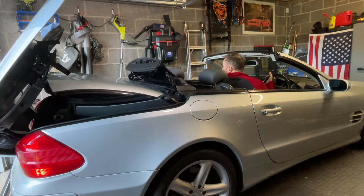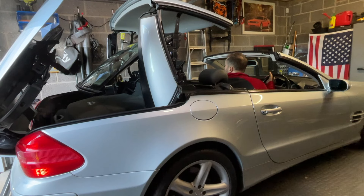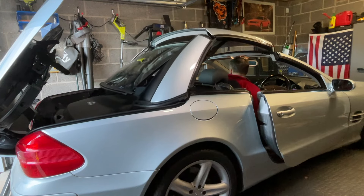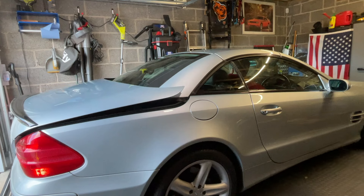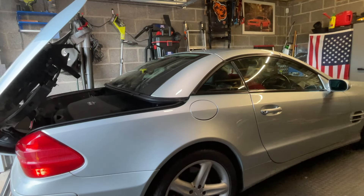Some people ask quite a lot about this on the web: how do you get the top to stay up halfway? When you stop pressing the button, after a few seconds the car will bong at you saying the roof is in operation, and then the roof will just drop. So you can either put a bit of wood or something between the roof and the windscreen to stop it, or what I decided to do is just do it with the engine running. With the engine running, the roof will stay in that position long enough — certainly enough time to do the rubber seals.